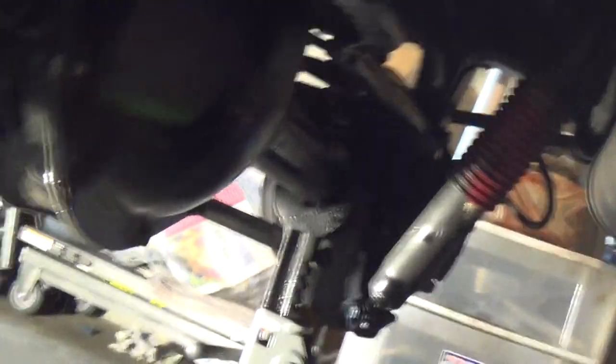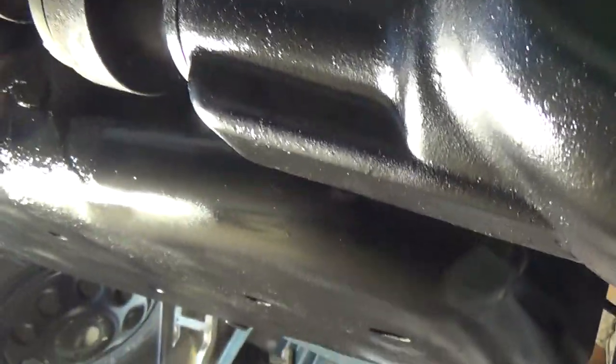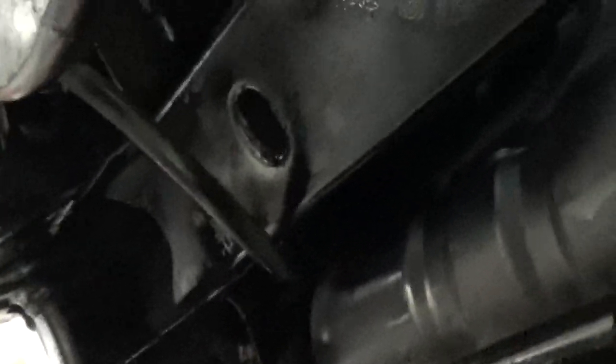The rear diff cover I scuffed down really well with the wire brush and wire wheel, then coated it. I did nice light even coats, keeping the can about 12 to 16 inches away and liberally misted it. Drying times varied — the product says about an hour but I waited about two hours between coats. If you've got time on your hands I suggest using it. Now you're looking at the passenger side coming through.